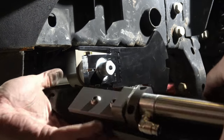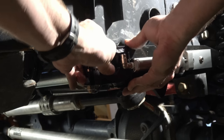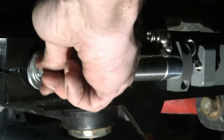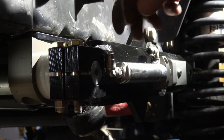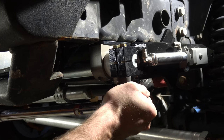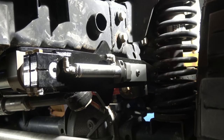Next, we're going to install the latching arm. Because I'm using the air-actuated version of this, I need to find a way to prop this open — I'm just going to use one of the jam nuts from the links. If you've got the mechanical one, you can just open it up and it will allow everything to fit into place. This arm is going to slip over the inside torsion bar. You have to have it pointed in the right direction so that it's keyed properly. We're going to use the same installation tool — this time without that big standoff spacer, just the larger flat washer and the nut and that stud. We're going to tighten it down and it should independently move from the inner torsion bar, then add that bolt and nut and torque it down to 45 foot pounds. The inner, outer arms and the dual arm on the other side are now installed.